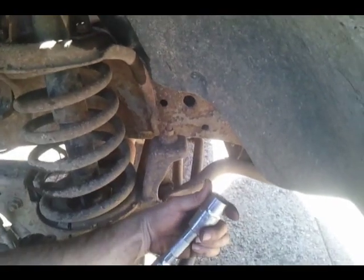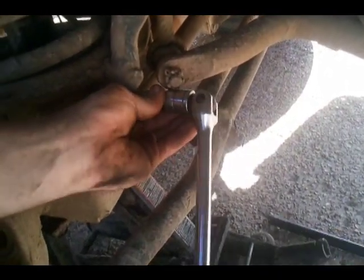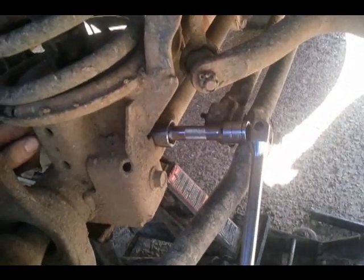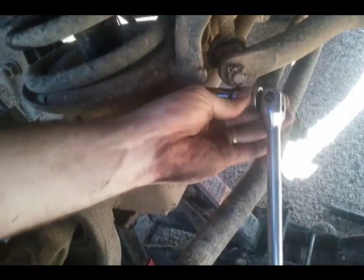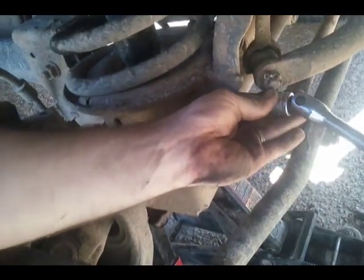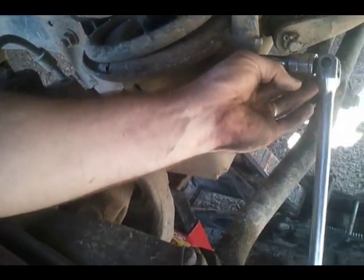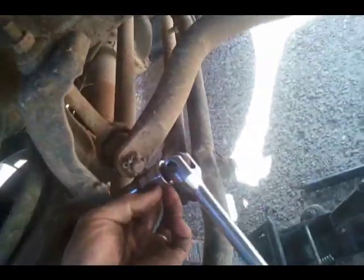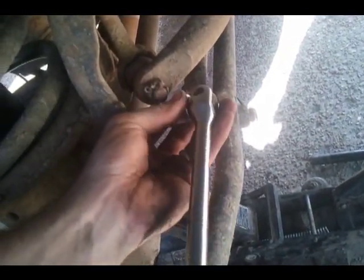Alright, so I got this attachment onto the breaker bar, and I'm using a lug nut socket that's a 13/16 to get in here. It's pretty easy once you get in there like that, because it has a bar right here, so you only need to hold one side. It's like a self-tightening system. It's a little awkward to get in there though. I used my 4-way lug nut wrench or tire iron to break the nut free.